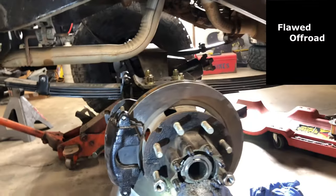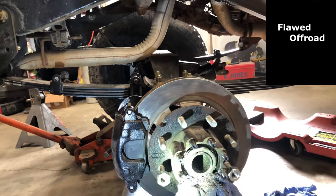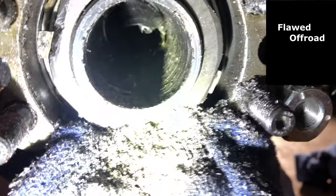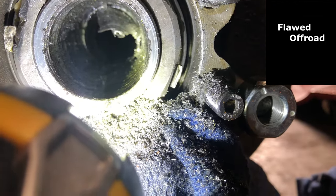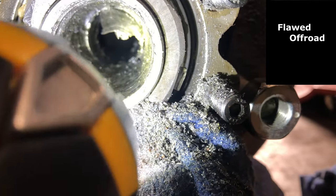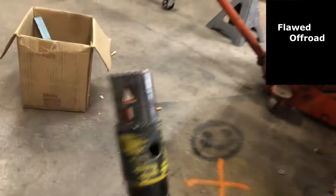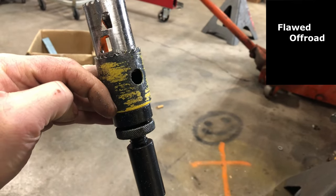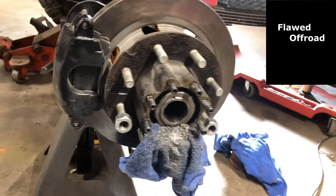Okay, I want to show you what I was talking about with those chips that don't clear, because the way this is cutting, it's leaving a sliver in there and it stays attached to the inside of the spindle. So you can see there's a big old piece of it hanging down, and that's because I took a pry bar and bent it down so that I can try to grab it with pliers and twist it and rip it out of there. Because what happens is, it basically goes in between these two saws and gets down to here and bottoms out in the main cutting saw, and then you can't cut any farther, so you have to find a way to clear them out of there.